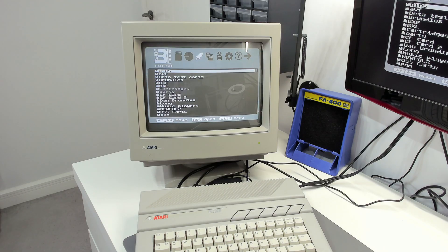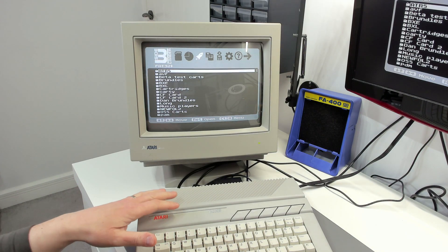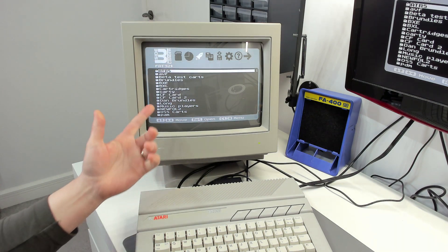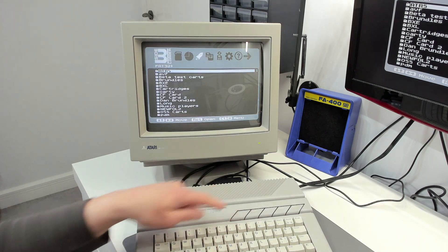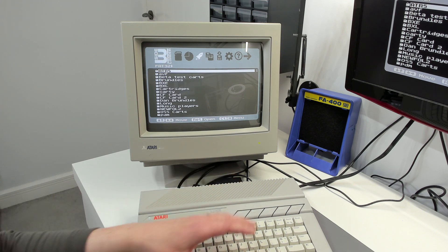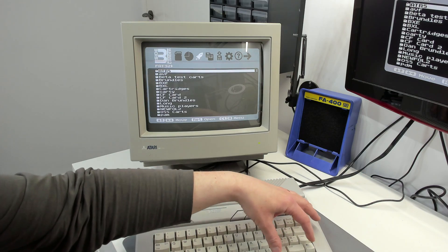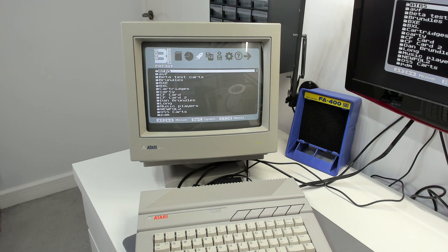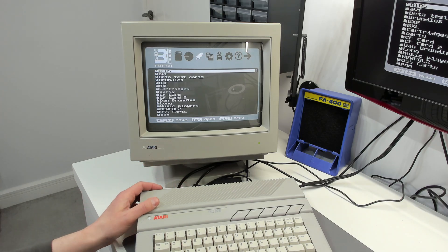I'm assuming the owner is going to be absolutely over the moon with this. As an afterthought, when I came to update the plugin using new flash and I used the SIO2PC cable last night, the problem started with the keyboard — the U key and a few other keys stopped working. So I had to have the keyboard out, but fortunately I was able to fix it with conductive paint. It was the end of the ribbon cable — the flex cable — some of the contacts had worn off. I thought, I've got to get rid of this machine now, because the longer it stays here, the more things are going to go wrong.